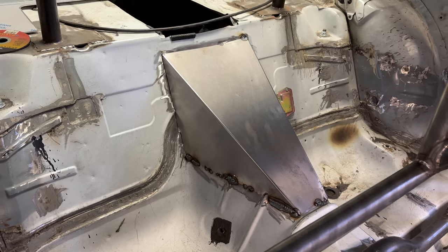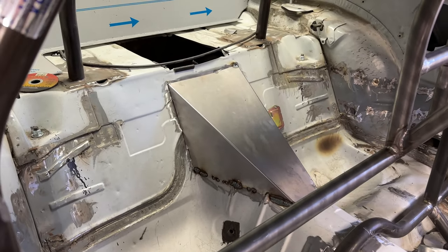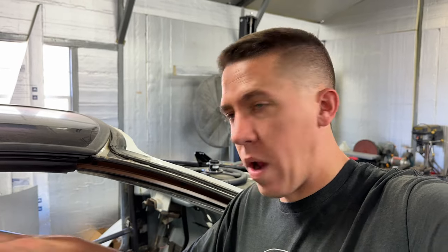Been working on getting all of the tunnel fit, trying to weld it around there, and work the metal in each spot as I go. It's coming along. I'll end up grinding and cleaning all that up and then putting some black epoxy stuff around it — that's what I did on Clyde — it helps seal it, takes the tinniness out of it, and keeps it watertight.